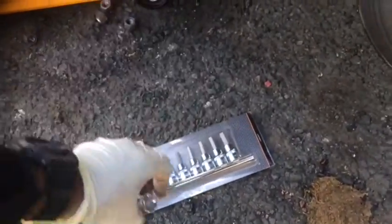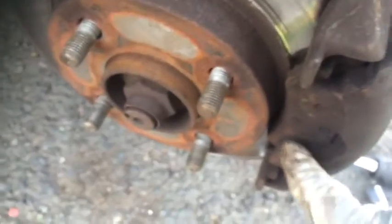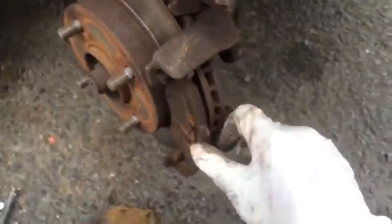What I normally do is loosen the top bolt and take the bottom one out fully, but in this case I couldn't, so I'll show that later. There was also a retainer clip I haven't seen in a while — that's got to be prised out with a flathead screwdriver. Take your time and watch your eyes. Once I've loosened the bolts, you can see the thread coming through — that's when you know it's getting nice and loose. I used my 7mm hex bit to take them both out, top and bottom. Now all I'm going to do is lift out the brake caliper. I had to take out the caliper and rest it in a position where it was not stressing the brake lines.